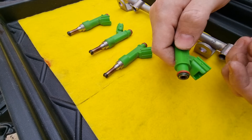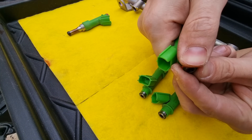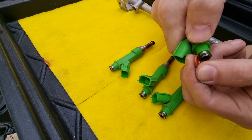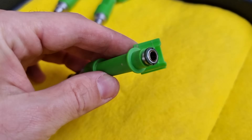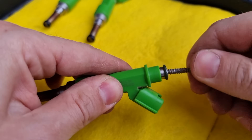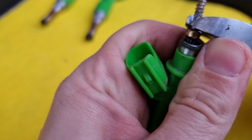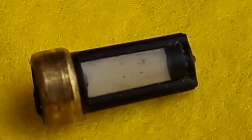There are two things we have to do before cleaning the fuel injectors. First: remove the o-rings — it's a good idea to replace them with new ones, but if I see they are not compressed sideways or cracked, I will reuse them. Second: remove the filter strainer, which is very easy to do with a wood screw and pulling it out. As we can see, the filter did its job holding some particles. Once removed this way, it will be damaged and needs to be replaced with a new one.